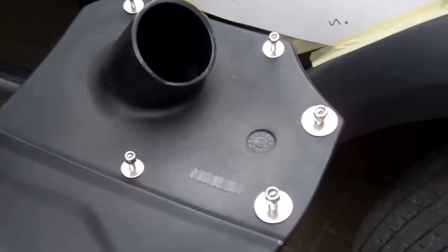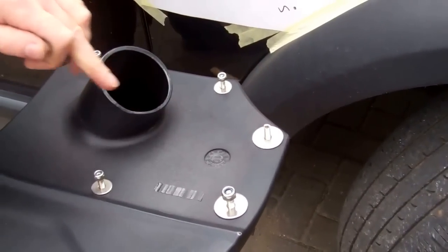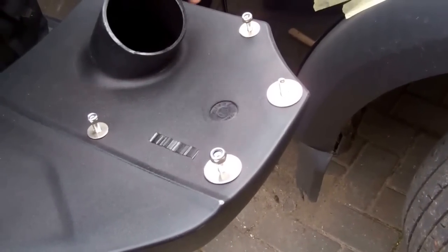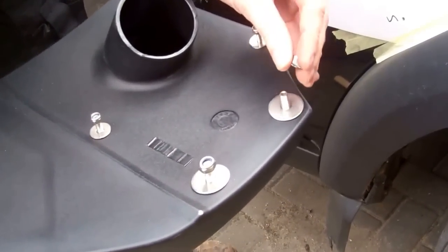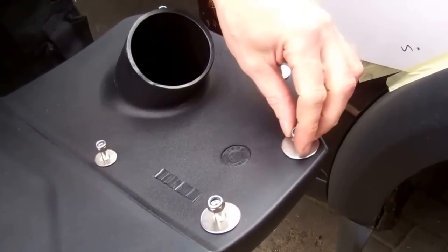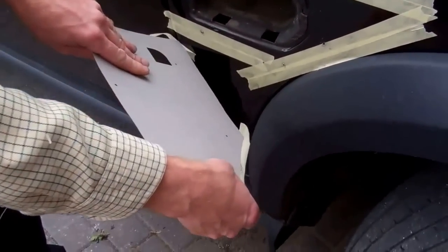If we look at the snorkel, these two studs already fitted are M8, and these are M6. It's up to you how big you drill the holes — obviously bigger gives more wiggle room if they're slightly off-centre, but too big and you'll be there all day. We're going to drill 3mm pilot holes first and then take them all out to 10mm. The pilot holes drilled a lot easier than the A-pillar we did earlier.